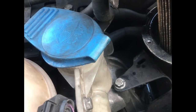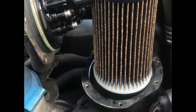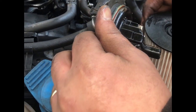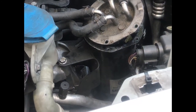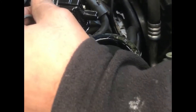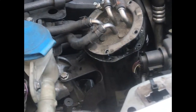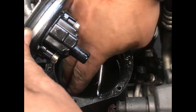I didn't get any rag here — it's impossible not to make a mess changing the fuel filter, so put some rags around so we don't get any fuel mess. The new fuel filter just sits inside the chamber there. It comes with a new seal as well — a new gasket, which is big and green. Just replace that and lubricate it with some diesel.